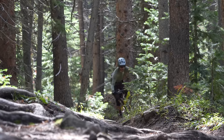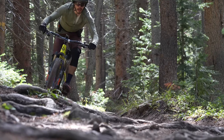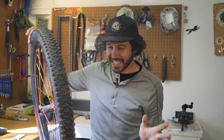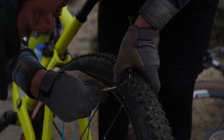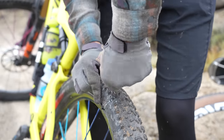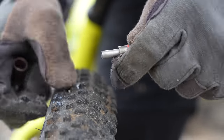When the tire was free of mud, however, it gripped really well both on dirt and off-camber rock and terrain. But in rockier conditions, I felt more bounce. It felt similar to other tires in this class but much more harsh compared to, say, a 2.6 inch tire like the Agaro, which I really love. The biggest issue was quick hits on rocks — on three separate occasions I actually got a pinch flat, and it didn't seem like it took much effort to accomplish this, not to mention a handful of near misses where the CushCore actually worked as intended.